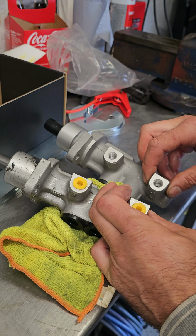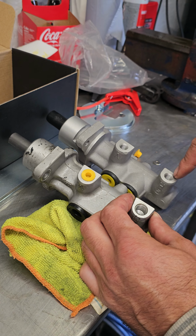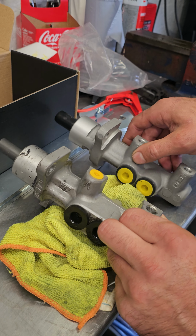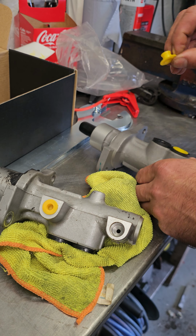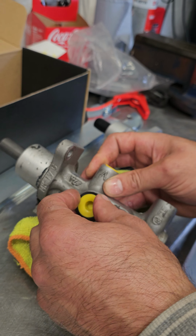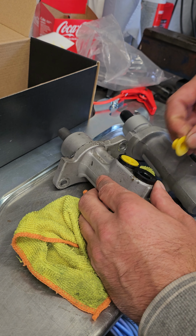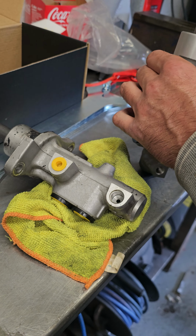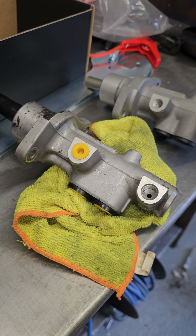Oh, we got the first problem, guys. So that won't be done straight away today because it's a different size of pipes, different threads. So I will have to flare the pipe. I've got the tool anyway. I'm making this video in two parts, so at least we know. Yeah, it's just tighter, but that's definitely a different size, so I have to modify the front section for a different end. Okay, I'll be back to you guys when I get this pipe sorted.